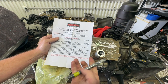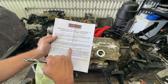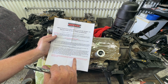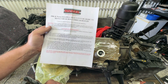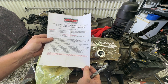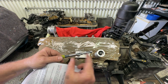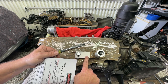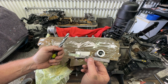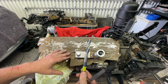Because I've done this a few times, I've marked depths on the drill. The instructions give you very detailed numbers on drill depth and measurements — all measurements are from the deck height. I keep this jig on the entire time. In the kit you get depth guides and things like that, so it is pretty easy, but triple check everything. You do not want to drill down too far or not far enough.